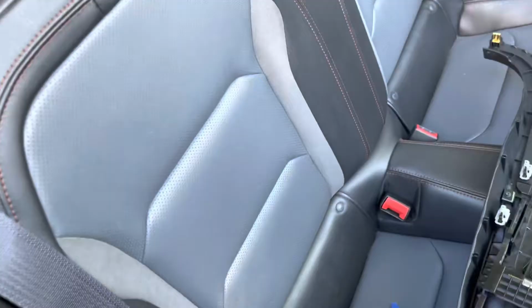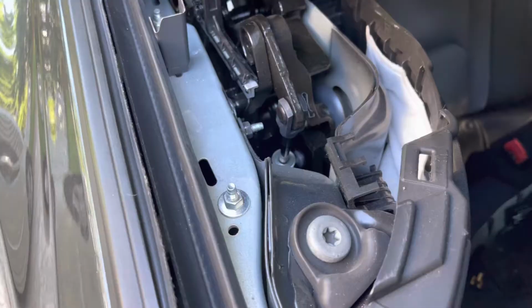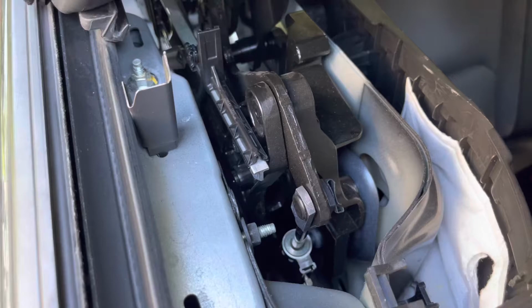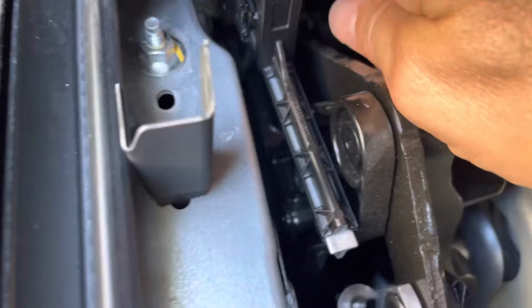So grease what you can. I'll put this thing back together and we'll talk again. So one thing to make sure you don't do, which is fine the way I did it: I put assembly lube on here, so really, really thick oil. I could have used WD-40 or something like that, but I feel like really thick oil would be better served here. I also greased or oiled the points I was talking to you about earlier, that pivot point and the one further down.